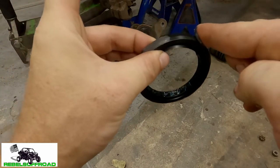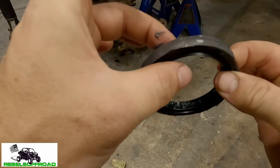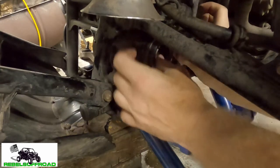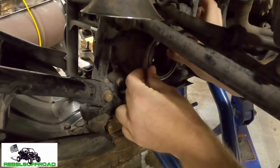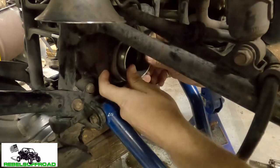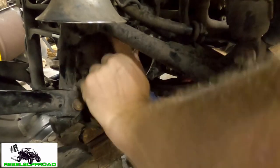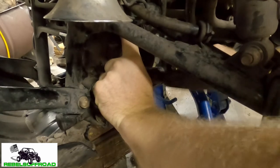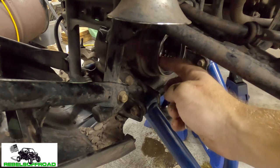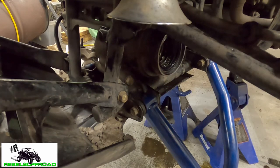It's able to stand some high temperature. Smooth it out a little bit — might have put a little too much on it but it shouldn't hurt anything. We're gonna fit it up to where it seats. I'm gonna take this old bearing race that fits pretty good right here, stick it up against the seal and take a hammer and tap it around evenly. That seal has a lip — once you hit it enough it won't go any further in, it'll back up into that lip, and that's when you know it's fully installed. We got that seal installed now.